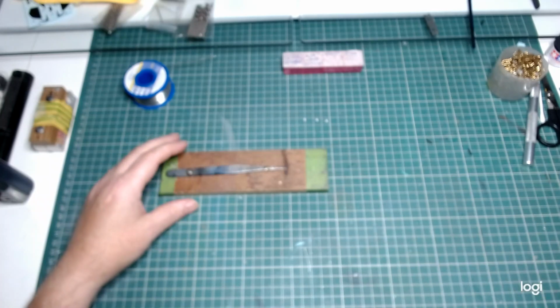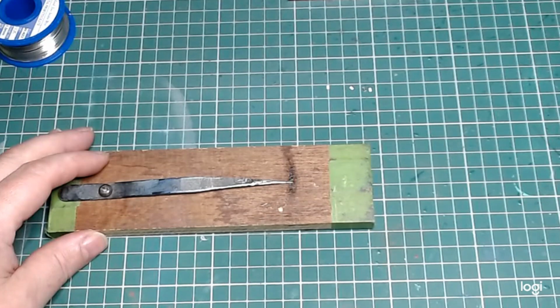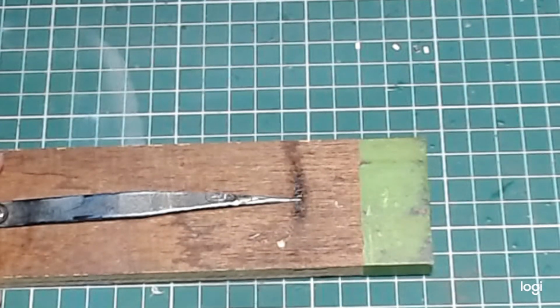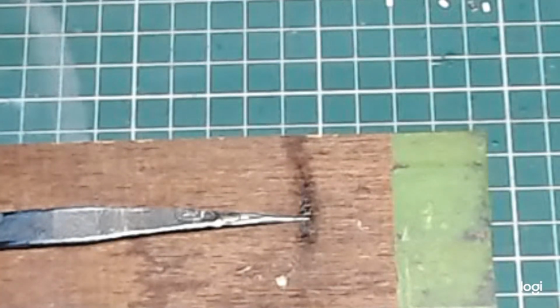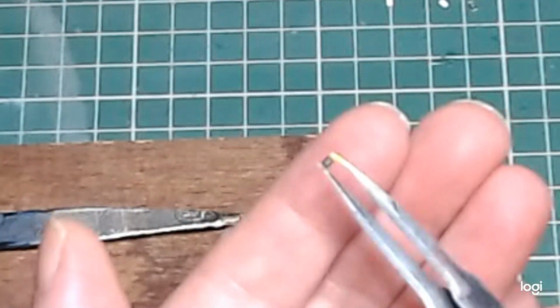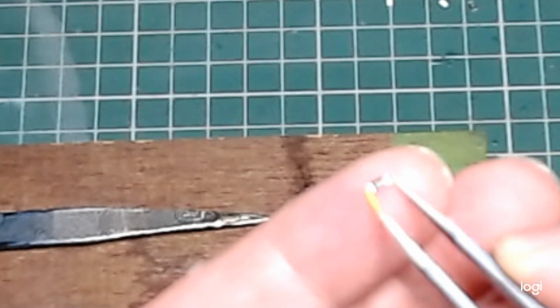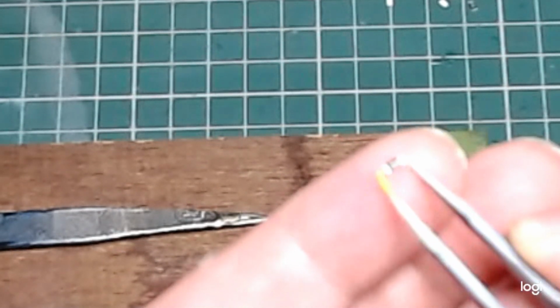So the resistors that I'm using, I'm going to zoom in a bit here, are 1206 surface mount resistors. I'll show them just in a second. I can zoom in as much as I can here without blurring out, pixelizing. Right. Well, 4 here on the table. So there's 1 and there are 3 sitting there. If you're wanting to find out exactly what these are, Google will tell you. So 2000 ohms was stated. Maximum wattage it can hold, I think it's 0.25 watts according to the manufacturer.